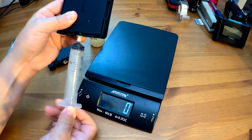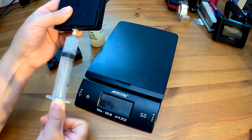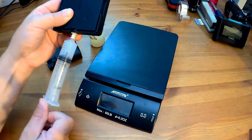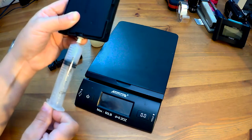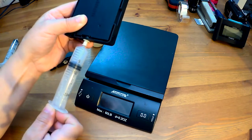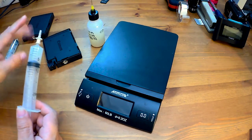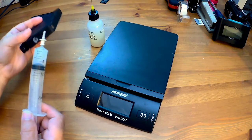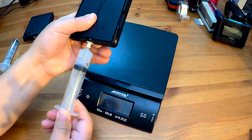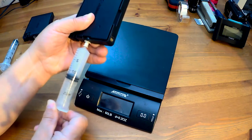At this point I'm pushing all the way in, sealing it, and you can see I am extracting some ink. In this case I got about 7 ml — I cannot pull any more ink out; the ink bag is totally collapsed. Now remember, the original cards hold a total volume of about 15–16 ml, so we'll do this with the second one and just continue pulling back.